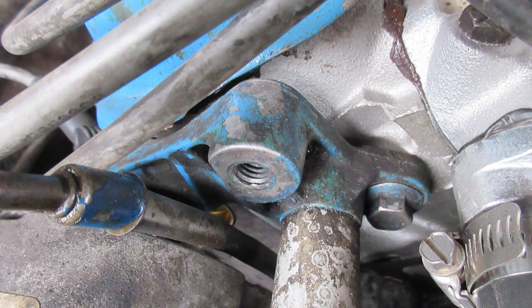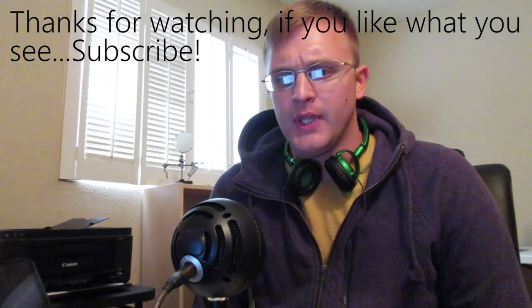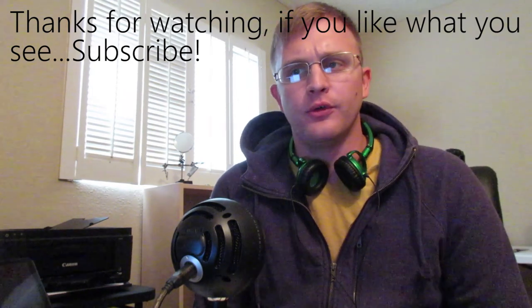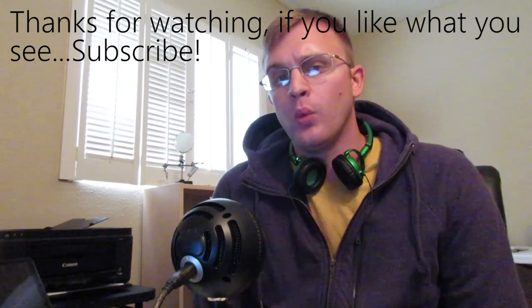The alternator bracket that originally came on my 302 already had two holes for the alternator bolt. The lower hole is what I used on my 302, and when I put that same bracket on my 351, I ended up using the top hole — so someone was nice when they designed it. My dad also did the same swap; I'll link his video below where he shows the engine off and running and talks about where he got it. I got my engine at the same place. The alternator bracket he had on his 302 was the same one I have, and it works. I'll include a picture so you can identify your bracket — if you have the same one, it'll fit.